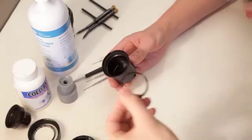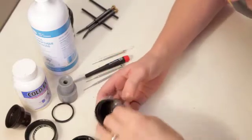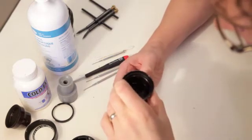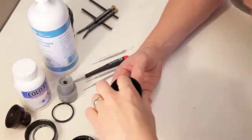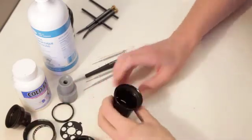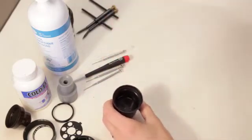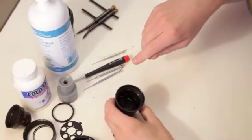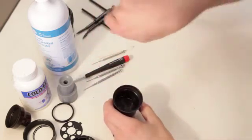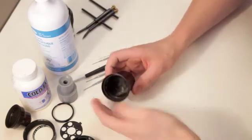Set that aside. Now we can press this down, be able to lift that ring up — and this is the actual aperture lever thing. There it comes out. Now all the aperture blades are sitting there ready to come out — they all point to the right. They're gonna be stacked. They're facing clockwise, and we're gonna stack them clockwise. Then, slipping in the last one, I'll show you all that. We're gonna bump them out.